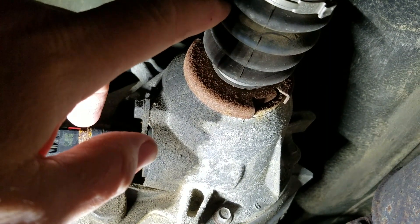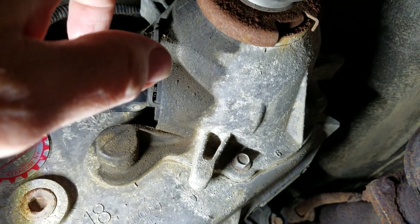The same goes for the front too — it's pretty much just from the middle of the last u-joint that connects to the yoke on the transfer case front output shaft to the actual pinion yoke. I come up with 31 and a half inches for the front. So those are the figures.